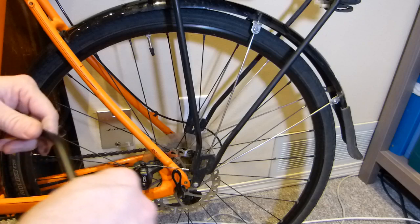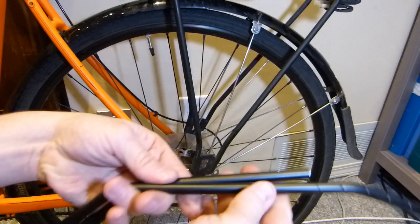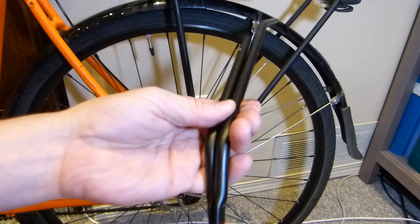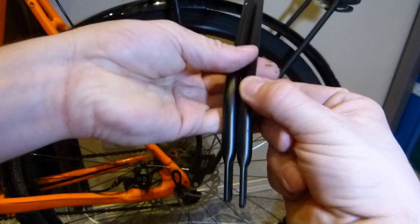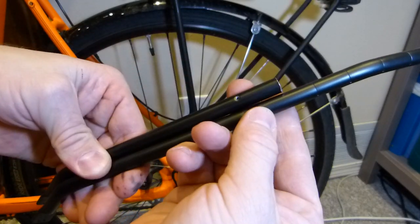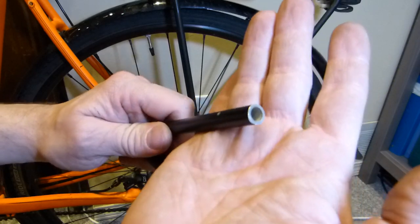This is how the components work together, and I'm going to go and get to work and make this bar just as short as that one. Probably, how do I do that? Probably I'm going to find a bolt that clamps both of these together here so that they are the same length. Not this much, just to hold them this way. Okay, and then I can just cut the second one exactly where the first one was cut and just file it a little bit with a flat file. And I also filed the inside with a round file, but why not?